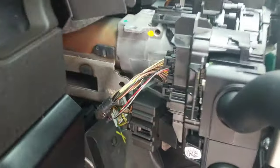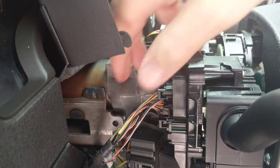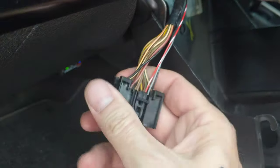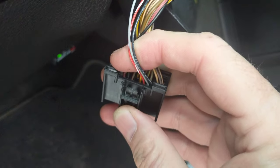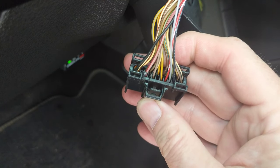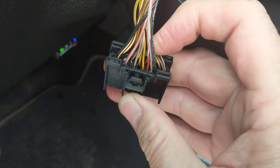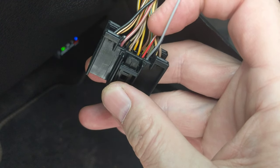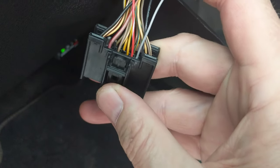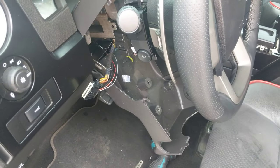Easy peasy on the back side, and you can see my wires are in already and pinned. We're going to pull that connector out and push in these three wires — these are from the shifter and they're in pin 3, 4, and 5. In the installation instructions it talks about the wire colors. If I remember right, it is red for pin 3, which in my harness is black, and then white, and then black, which is red on mine. Again, this is the prototype and the instructions talk about that specifically. All in, probably 15 minutes.